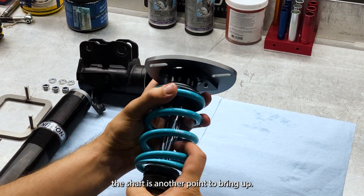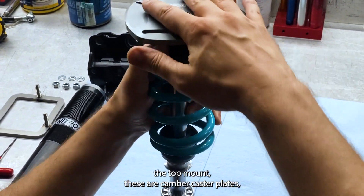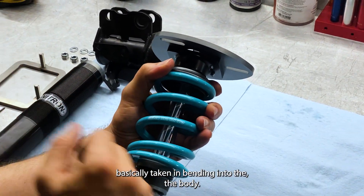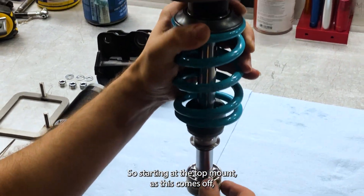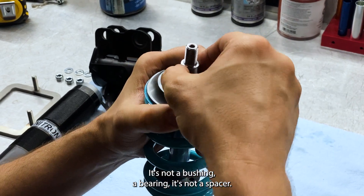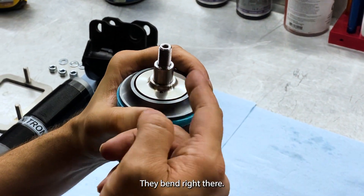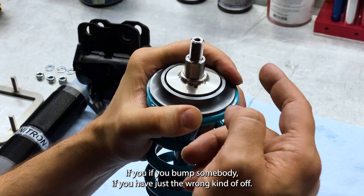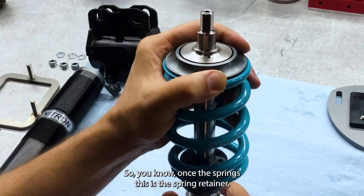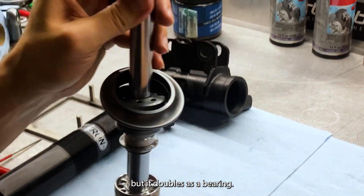The way loads are taken through the shaft is another key point. From where it mounts to the chassis at the top mount — these are camber/caster plates — the load is taken in bending into the body. Starting at the top mount, as this comes off, you can see that this post is a continuous part of the shaft. It's not a bushing, a bearing, or a spacer — that's a point of weakness for a lot of shock assemblies; they bend right there if you bump somebody or have just the wrong kind of off. These almost never bend because it's an 18mm post that fits right into the bearing, so it's really strong. The spring retainer doubles as a bearing.